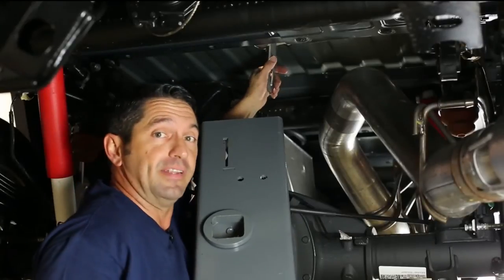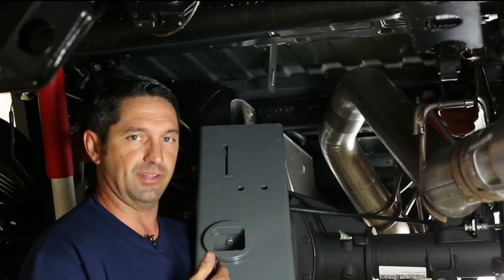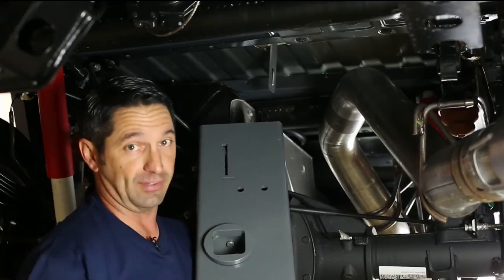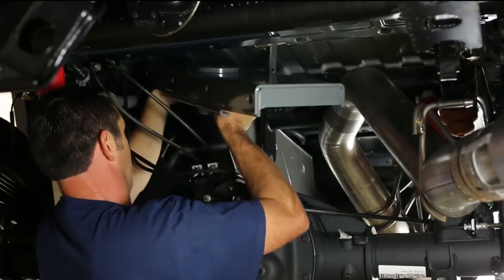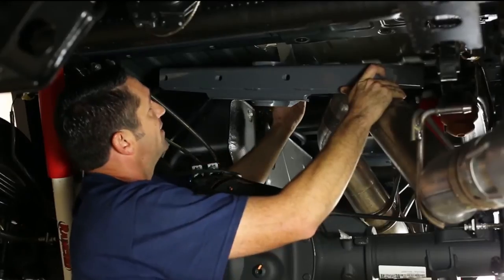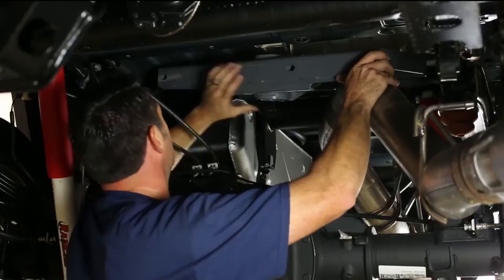We have the overhead lifting device in place on top of the bed. You'll notice that the receiver socket for the ball is offset to one side of the center section — this needs to be oriented to the rear of the truck. You'll also see a groove for the release handle mechanism, which needs to be oriented to the driver's side of the truck. I'm going to lift this up over the differential, get it up over the fuel tank, then swing the right side up over the exhaust. Keeping that exhaust down from earlier gives us more room and clearance to work under here.